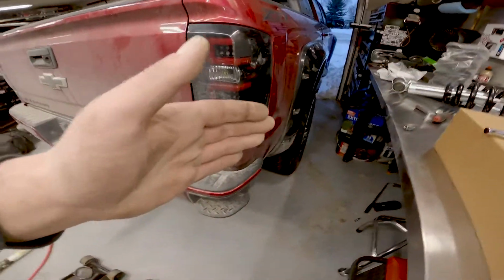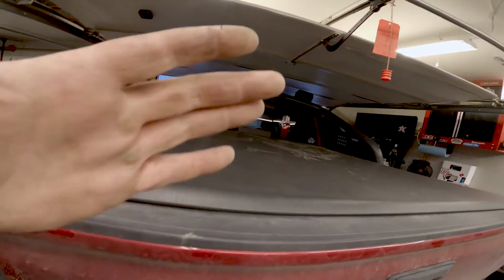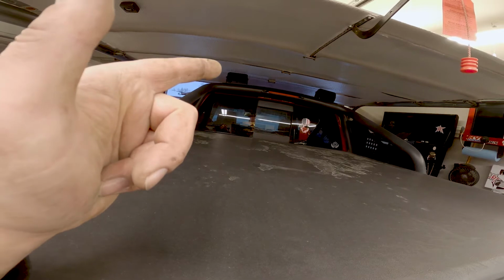But ultimately, you can do this completely. I mean, the truck's dirty, but this is simple. Just take your time, walk through the steps, and you'll get it. Take the wheel off, take the caliper off, take the caliper mount off, disconnect the shocks, put it all back together. The caliper, I did use the C-clamp method, which is use the old brake pad, crimp the C-clamp down on the caliper. Life is good. I elected to unbolt those, so those are loose up top, just so they drop down a little bit. You probably can't tell, but that's dropped down a little bit.